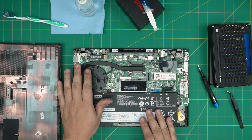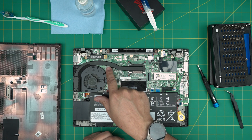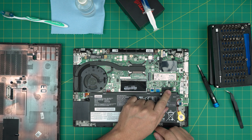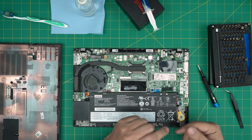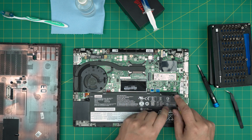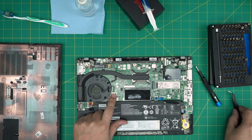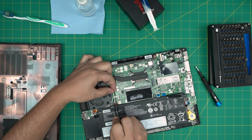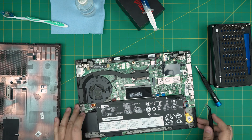Inside, we can see the battery, the fan system, and the whole heatsink. Some configurations come with a GPU installed here, but this is a CPU-only version. Before doing anything inside, disconnect the battery. There are two ways: pulling the connector backward, which is the safest, or disabling the battery inside the BIOS. Pulling the connector is highly recommended. Once the battery is disconnected, remove the fan connector. Don't pull on the cable itself — it's fragile. Place tweezers on the side of the jack and gently push it back to disconnect the connector.